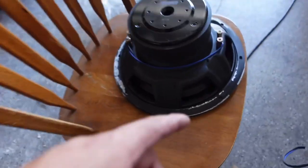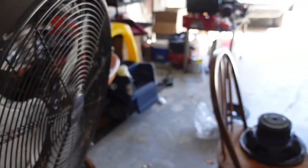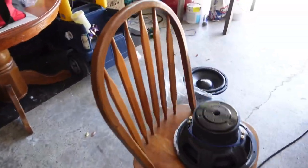I'm creating jumpers. Kicker subs you have to wire them up a specific way because of the dots - I don't know if you guys ever wired up kicker subs but they have dots you have to jump into. I looked up online since these didn't come with a manual, double checked, and did the outside inputs for positive and negative. With it being dual 2-ohm, jumping it bridges up to 4 ohms, so once I bridge each one, my last sub should get me to 1 ohm.